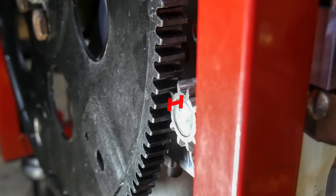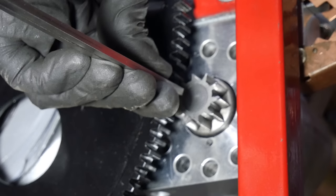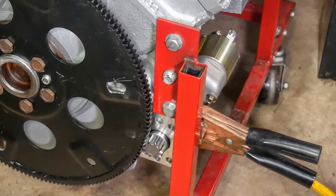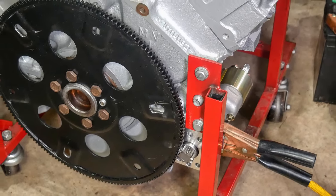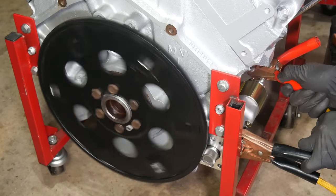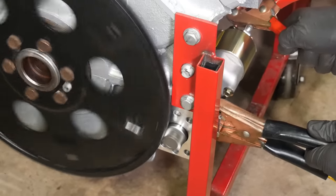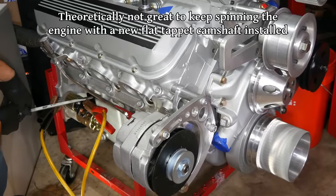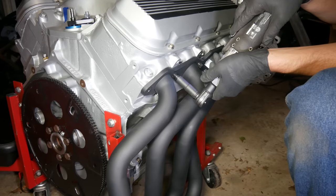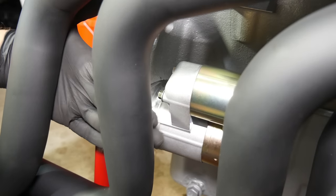What I don't love is the width of engagement between the pinion and ring gear. You typically want between a quarter inch and three-eighths of an inch, and in this case we're only seeing about 0.27 inches, which is technically okay but all the way down at the low end. We'll see if we can improve that in a minute, but right now I really want to see if we can get the starter to turn the engine over. This time we're connecting both the solenoid and motor feed terminals. This mini starter uses six-to-one gear reduction, and at least with no spark plugs in the engine, that motor is perfectly willing to turn it over. The solenoid isn't directly up against the tubes, but it's not exactly far away from them either.